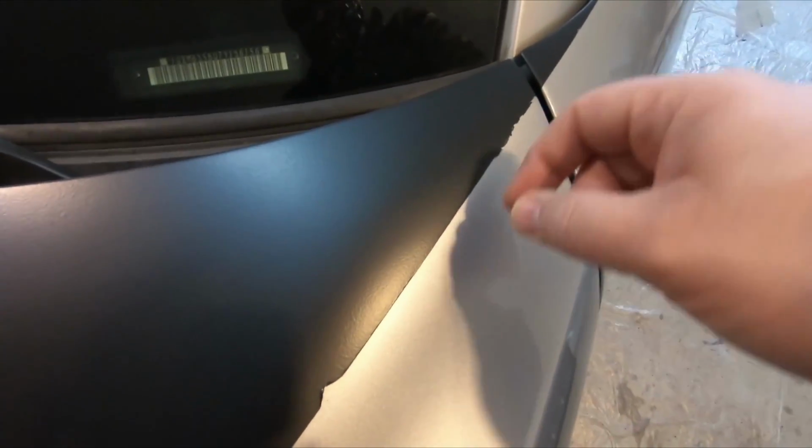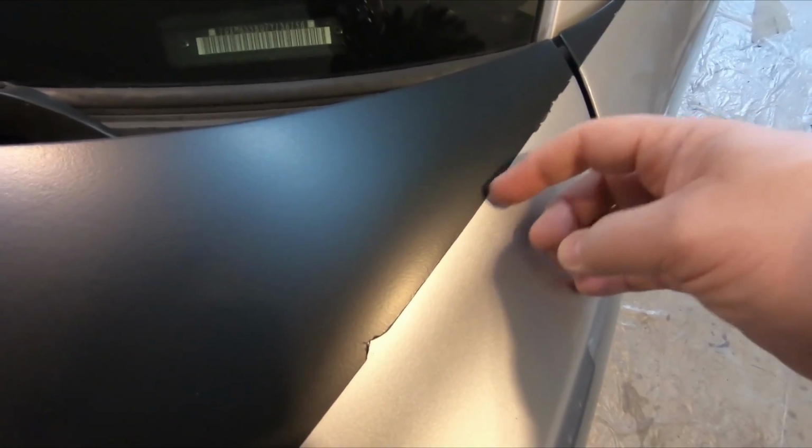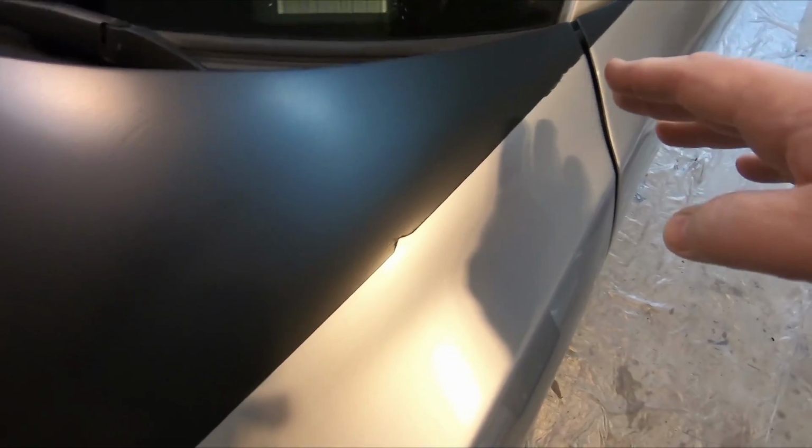The problem in this area is that as I was pulling, the tape broke. So I had to scratch it off to get it started again, and I would pull it and it broke. By that time, this paint edge started drying. I couldn't wet it down again because I already had the mask off of there. So that kind of screwed me. But when the tape was complete and didn't break, the line looks really good. Of course, it happened again down there as well. This entire line on this side looks really good. This is where it actually pulled and didn't break at all.